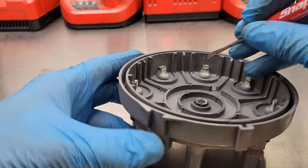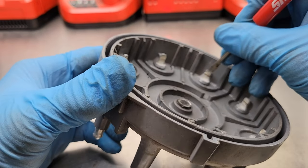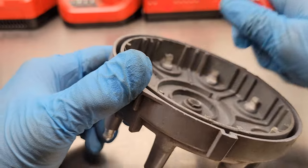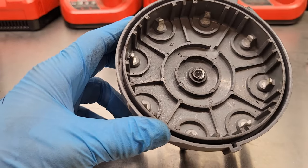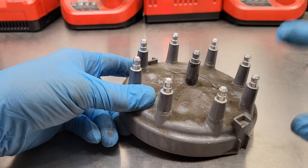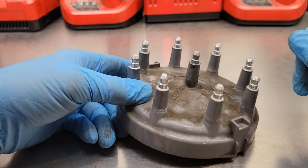With your terminals, if you get a whole bunch of buildup and you don't have a cap on hand or have to wait for one to come in because it's not in stock, sometimes you can take a screwdriver and scrape off the buildup. Sometimes it comes off in big chunks, or you can use a little piece of sandpaper to clean it up. It might be just enough to get you back on the road until you can get a new cap and rotor. Also watch out when doing your wires — if you pull the old wires off and see a whole bunch of corrosion, check the inside of your spark plug wire boots because that corrosion will be in there too. It might be a good idea to order a set of plug wires while you're at it.